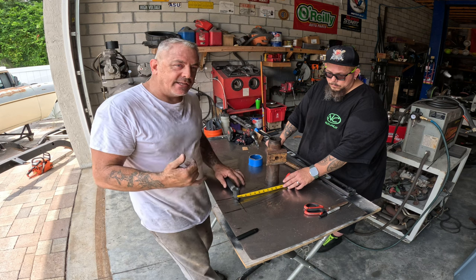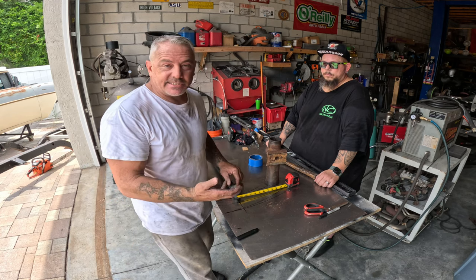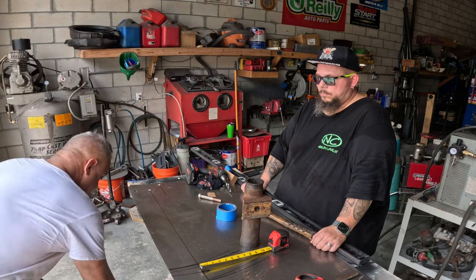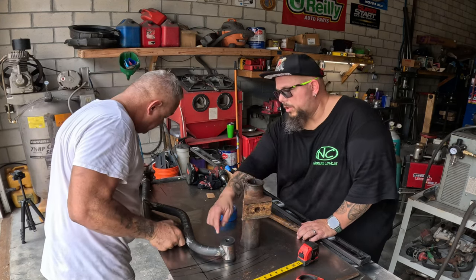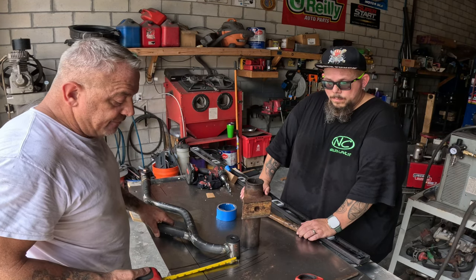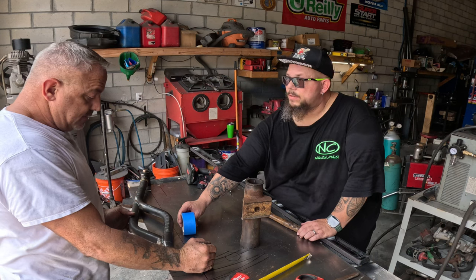Number one, I really should contact the customer and ask where they'd feel comfortable cruising the car — two inches off the ground, three inches, four inches — because that's going to change the amount I have to account for coming off the back of the axle. That was one of the things I wanted to point out. Getting back to my fancy bar — if I use this bar shortening it two inches and mounted here, she'll have to go almost five and a half inches to get the bar parallel to the ground, which is way less than where the bag mounts to get that amount of lift. So that's perfect.